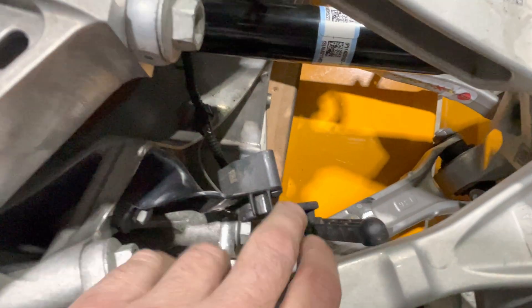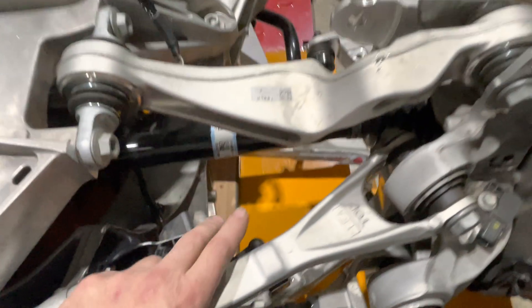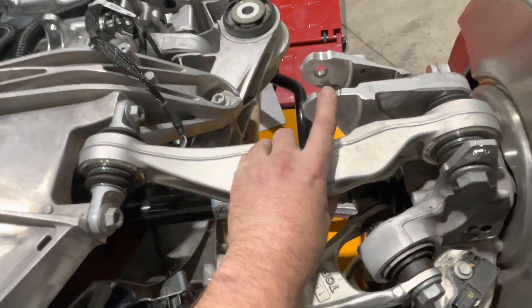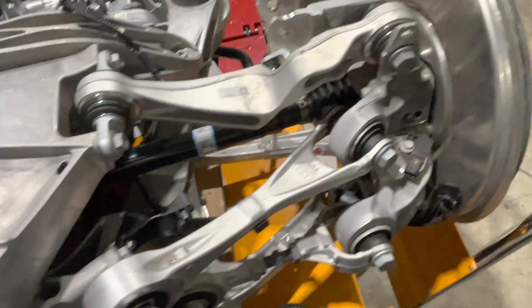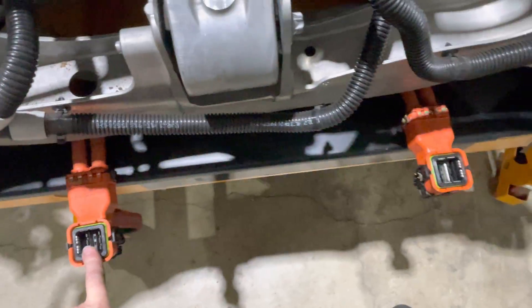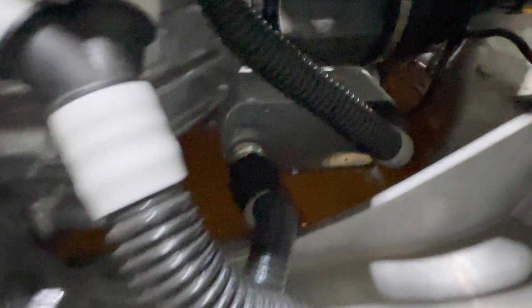This is the ride height sensor for the air suspension. What's not shown here is the upper combination shock absorber and air shock that supports the suspension, so the suspension is basically unsupported as shown. These are the two cables that plug into the bottom of the battery. Down in there we've got our heat exchangers that use glycol to cool the ATF-9 synthetic oil that's in there. You can barely see the other oil pump for this side, and again it's pretty much symmetrical, same thing on the other side.